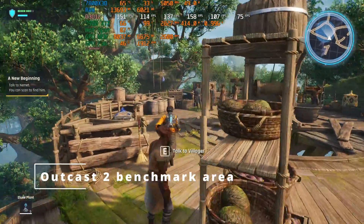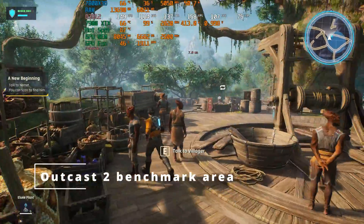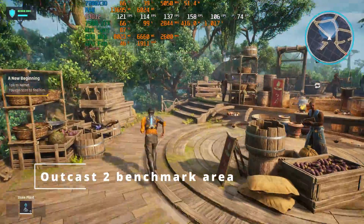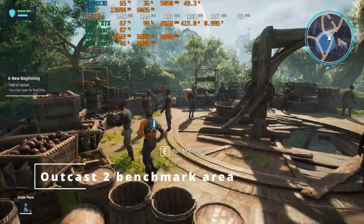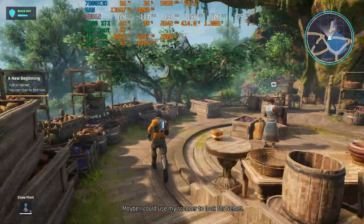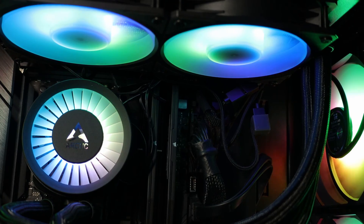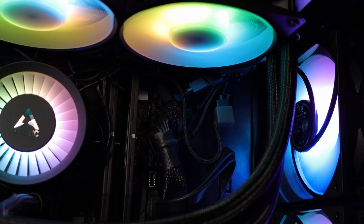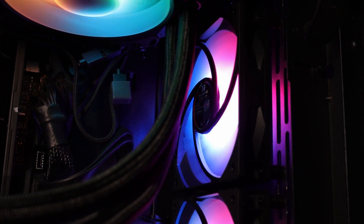And there you go. The best position for an AIO boils down to where you have room for it. If I had to choose, I would always go with a top installation over the front one, as this reduces the temperature of the GPU in mixed workloads. Regardless of which position you choose, you just need to define a good fan curve that balances airflow and noise. If you found the video helpful, help the channel grow by subscribing, click the like button and drop a comment below. Take care and hope to see you all in the next one.